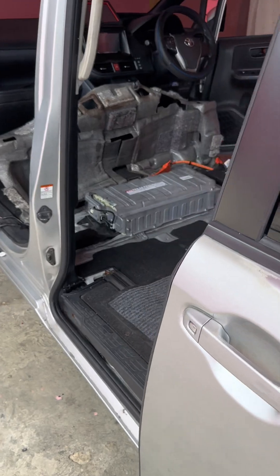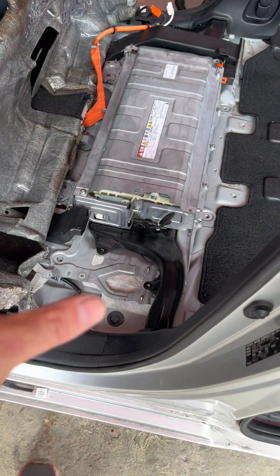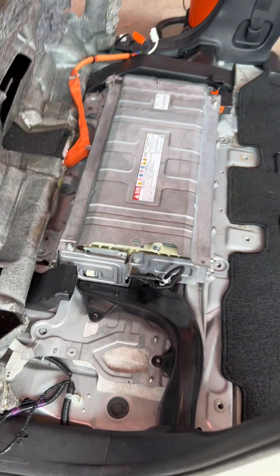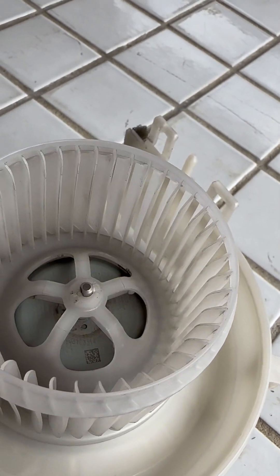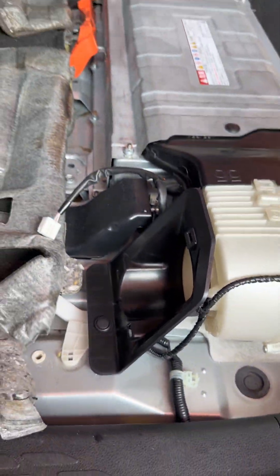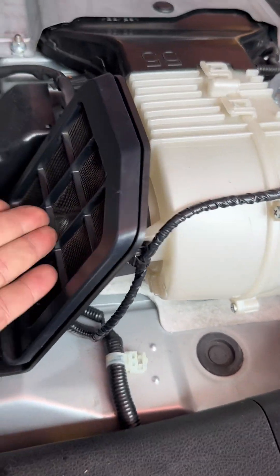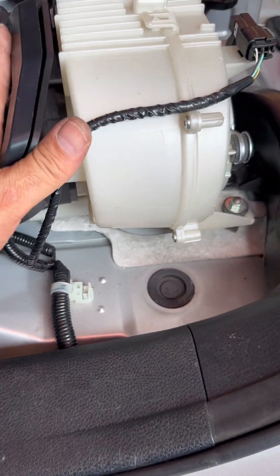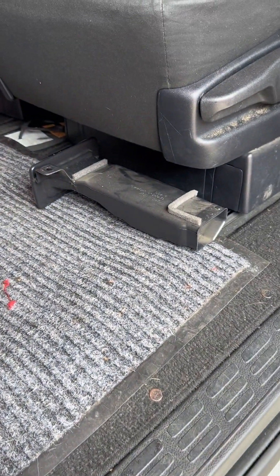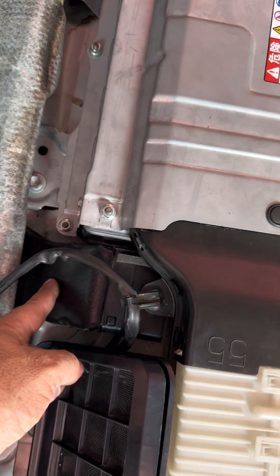The battery goes under all this interior trim. The air blows in right here and has two exits on the bottom — that's how it works. When you clean your fan blades, they look as good as new. Don't forget to clean this filter, and then the battery intake — you see the little clip, we assemble the filter. It's a serviceable filter that should be taken out every couple of months. There's also one little ventilation for the air conditioner. The exhaust goes on one side and this is the air conditioning outlet for the rear.